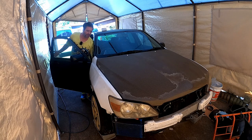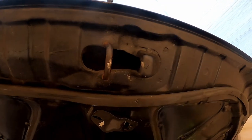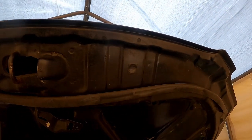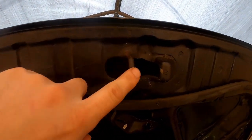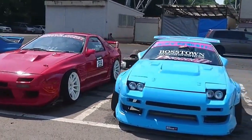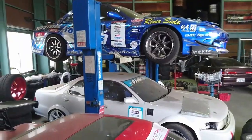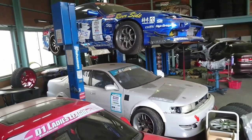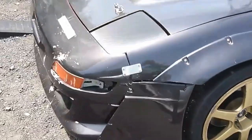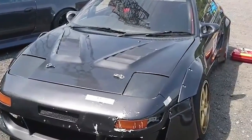The bonnet is held down by the standard latch, but it is always recommended to put in bonnet pins because these things fail. If you take notice of Japanese track cars, a lot of them use the standard old school type, and I wanted to know why, so I asked a legend D1 driver, and he says it's because you can literally see if it's locked or not, often from the driver's seat. It can't fail unless the pin falls out, but if the pin falls out, you can see that. So it is a safer option, no doubt.